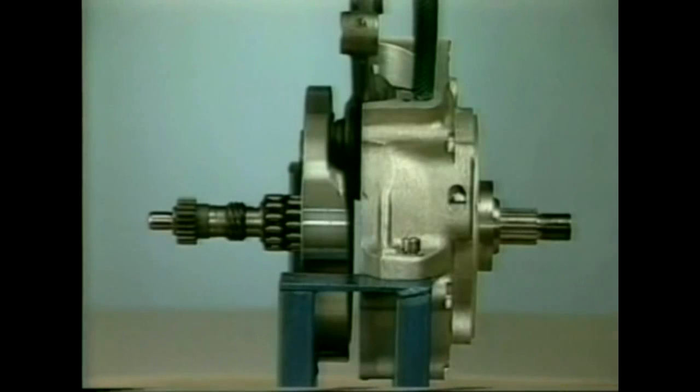The pinion nut which locks these parts onto the shaft has a left hand thread and is tightened to 40 foot pounds torque. Looking at the conrod journals or big ends, we see what is called a knife and fork bottom end, which is unique to this brand of motor. The whole crank will need to be pressed out from the remaining case when being serviced. We recommend taking the complete crank as-is to a reputable workshop for any further servicing.